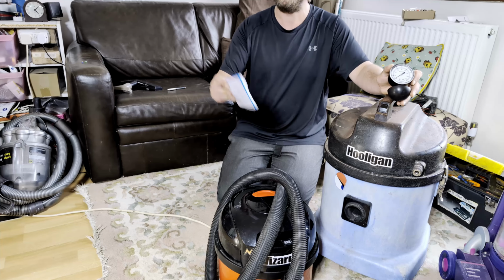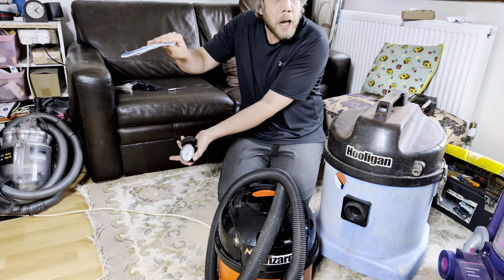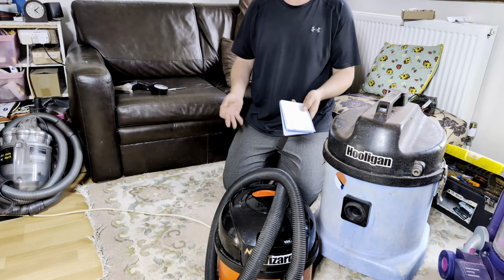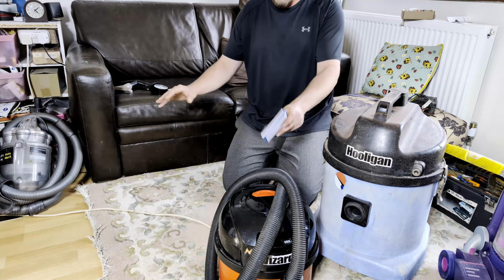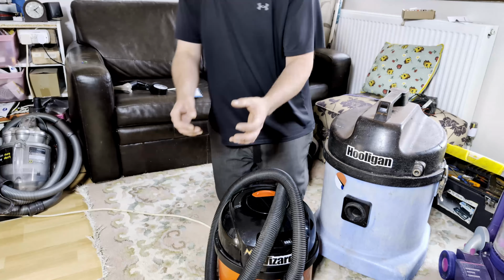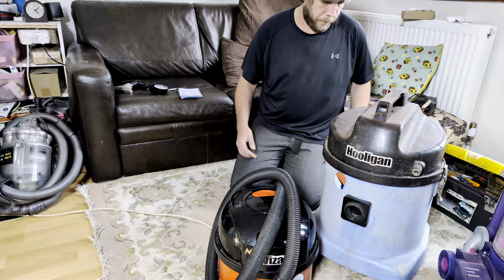And I'm hoping that with enough data, and again with all these Dysons, I'm going to put their serial number down where I can, so we can build up a list of DC04s, a list of DC01s, and so on. And in a year or so, we can probably start to filter some good graphs out of it, so that when I say, oh, this vacuum cleaner that I've just spent £95 and 5 days of my life on has improved by 12 inches of water lift, is it worth it? Or we can laugh at the really clogged up Dysons that come in probably with not a lot, and then we can improve the heck out of them with £3 worth of filters and a bit of a wipe down.